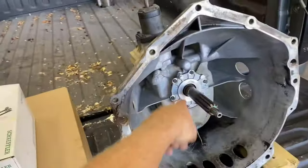But this is your pedal assembly, or clutch pedal assembly. It's just held on by 3 bolts, and you might have an electrical connection. I didn't for this application, but for your master cylinder here, it's just a little push tab, and this unlocks from inside the firewall. I'll show you guys when we go to installation. I don't know why I'm telling you how to install and uninstall. But you're going to need your pedal assembly, and I'd imagine that's a part number, but like I say, all the legit part numbers will be in the description below. We're filming as we go, you know, we've got to weed out all the wrong stuff.